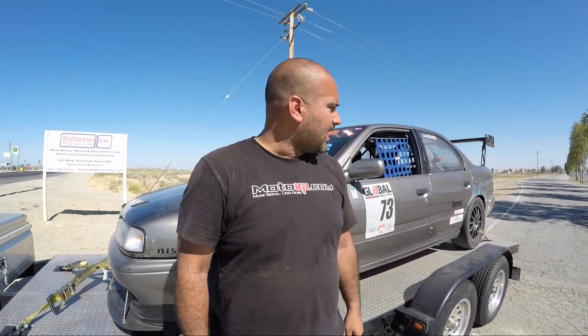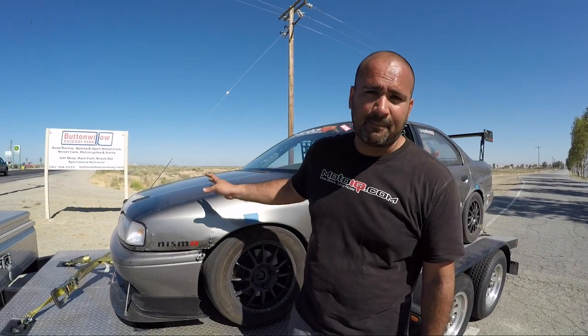We may tinker with potentially putting in a higher PSI valve. I believe Wilwood does make a 6 PSI valve, so we'll try that next time, potentially to test this at California Speedway in the coming months, since that's where we actually experience the majority of this problem that we were having. Unrelated to the braking system, our fan decided to stop working.